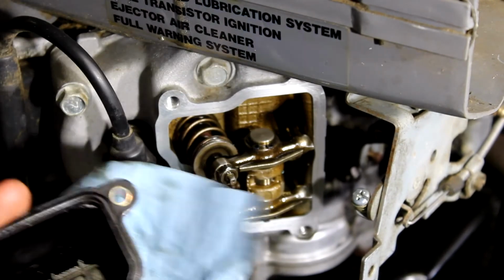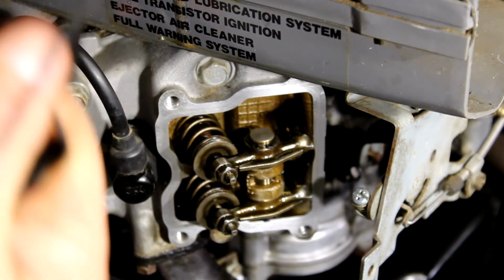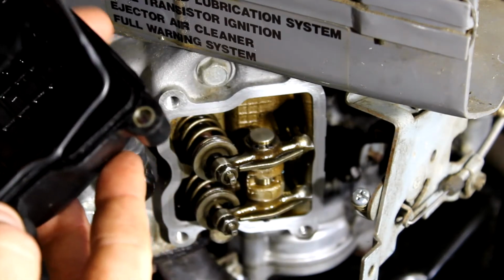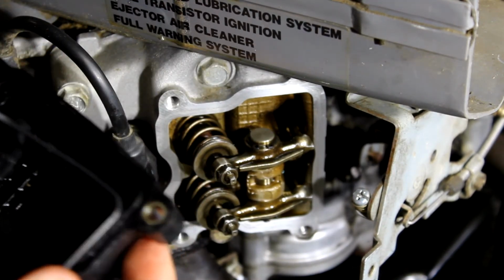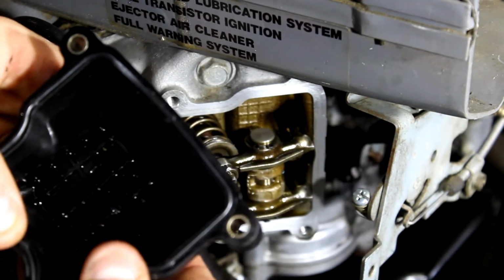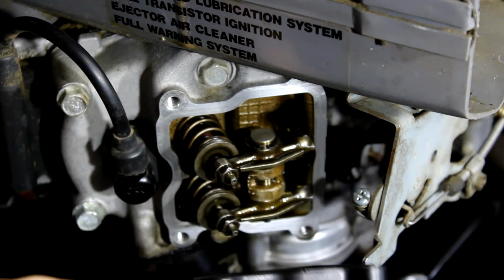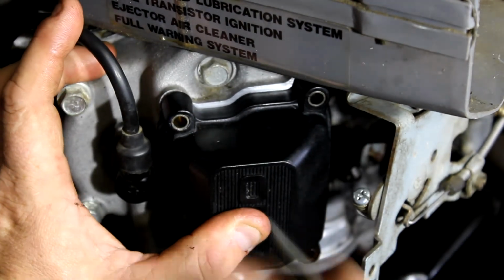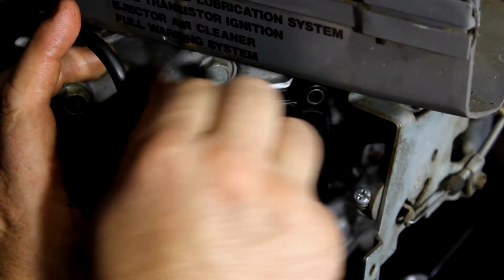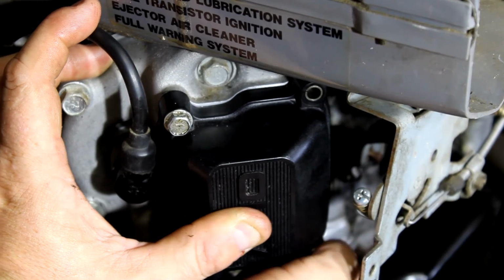Get your valve cover, clean that off. Take your old valve cover gasket out. Get your new one. Get it all lined up. Pressed in the cover, and then very carefully making sure the new gasket doesn't fall out of that groove. Press it up against there. Get a couple of the bolts in there hand tight so you know that little gasket doesn't fall out or get crushed when it slides out of the groove.